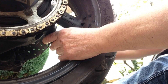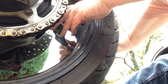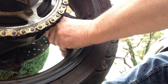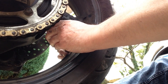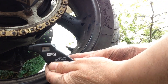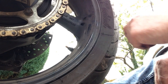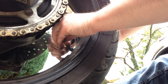The rear valve is considerably harder than the front. There is no way that the tire pressure gauge will go on straight — you have to pretty much push the valve over quite some way, and that is not ideal. Let's try and take a reading off that, which is not great. That's got just over 30.5 psi, so that's doing a little better. The front was right down on pressure. We'll fit our right-angled piece on.